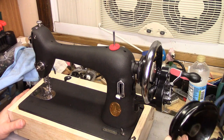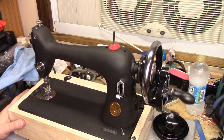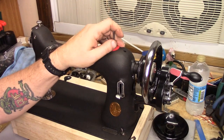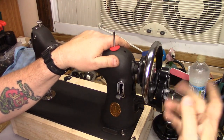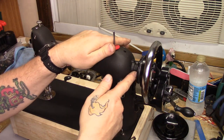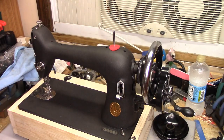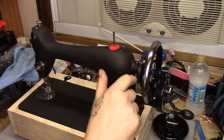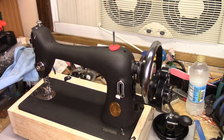You can go from a motor with a solid wheel to a Chinese hand crank and a Chinese spoke wheel for about 50 bucks via eBay. That is, if you don't have an original nine-spoke wheel, the eBay stuff will work. If it doesn't fit properly, just remember: a stone and a rotary tool — deburr it. Check which way it fits, make sure it fits in both directions, and double-check the gaposis. The customer did not send me the bobbin winder with this machine, but she has since sent it to me — I'm going to do her bobbin winder when it shows up this week.